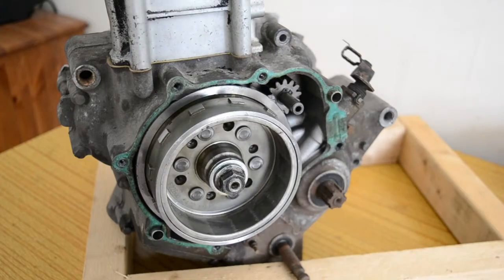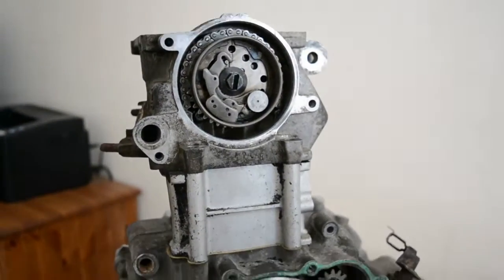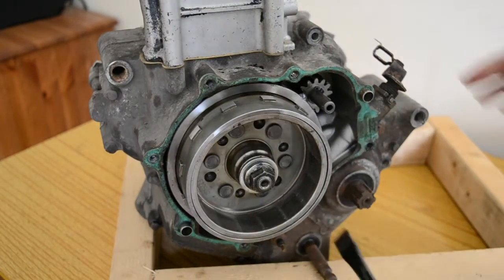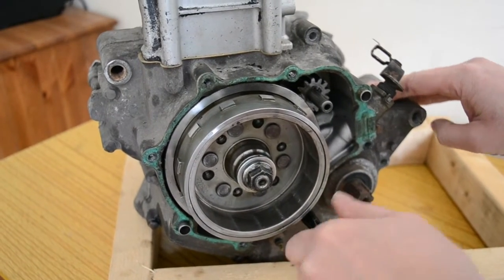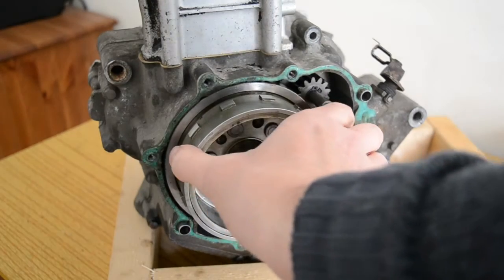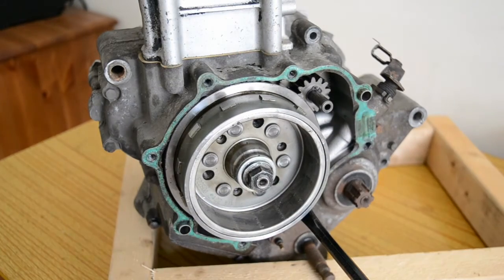Just check your marks again — you can check there, and also check there at the top. This is spot on. So I jam a chisel in there; I usually put some tissue around it just to stop damaging the flywheel, but I forgot to. That just locks it in place so you've got less to worry about.